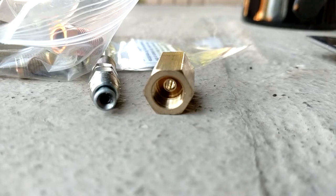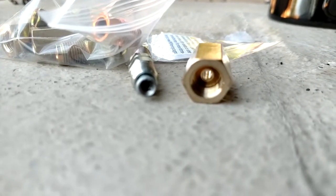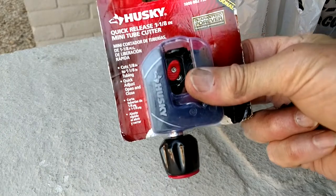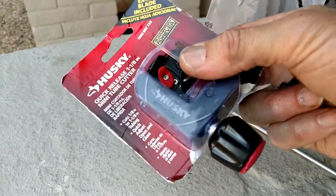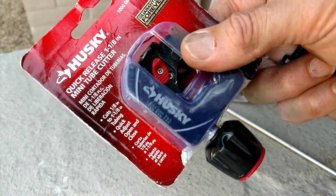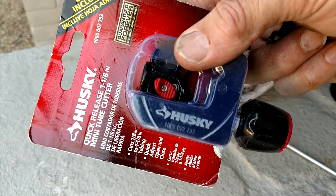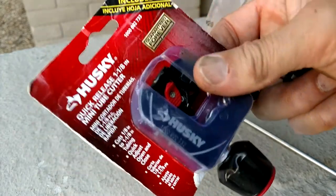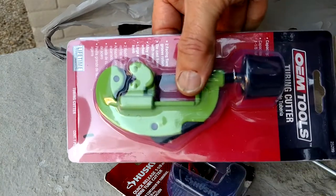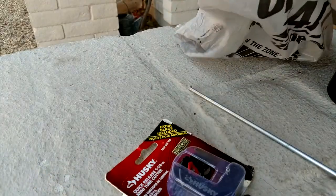Here's a look at the flares of the splice itself and the tubing that it's going to mate to. What I needed was a tubing cutter — you want very good, sharp, clean cuts on the brake line you're cutting. Otherwise you're going to end up with a buggered flare that's not going to seal right. It could be done another way — you could saw it off and file it flat — but the tubing cutter makes it easier. The brake line flaring tool I bought at the auto parts store is much larger; it's a great tool, it's just too big to swing in the area I have to work in, so I went with the other one.